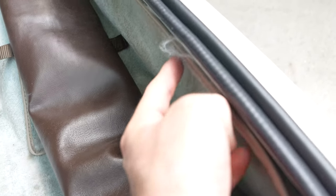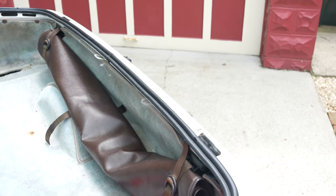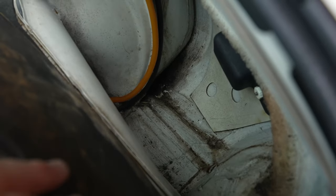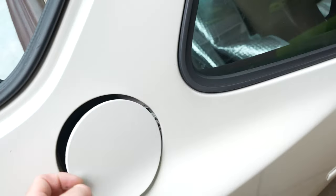Mine came with a little sunroof bag because the sunroof on top is completely removable - you can pick it up and put it back in the bag to keep it protected. This big piece of carpet is also completely removable; you just pop the little tabs out and you can access your spare tire, your jack, your toolkit, and all the information is under there. There's a little sticker back here that gives your whole option list for your 944. Then there are two little cubbies on either side - they get dirty as water can get in - but that is how you change the side marker lights. You also have your sunroof drain and a gas overfill drain in case you accidentally overfill the gas tank.